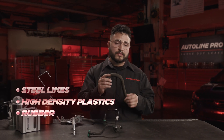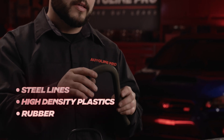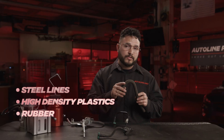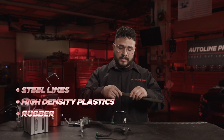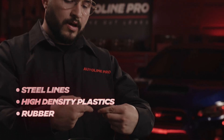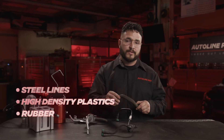Lastly, we have rubber hoses, which are designed for more flexibility within the system. Out of all hose types, rubber can crack the most due to vibrations and flexing. A good way to test a rubber hose is to flex it the opposite way of its resting angle — if you see any cracking, the hose is bad and there could be seepage of fumes.